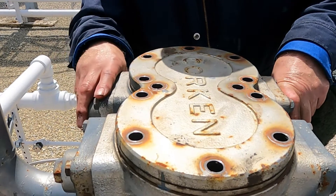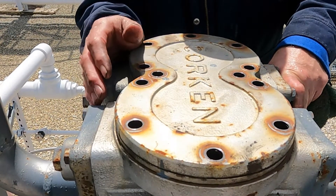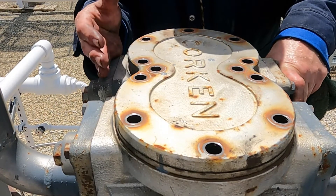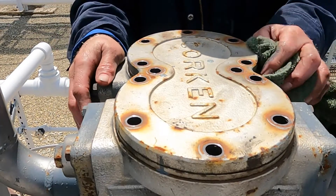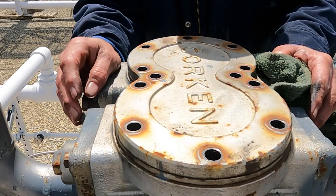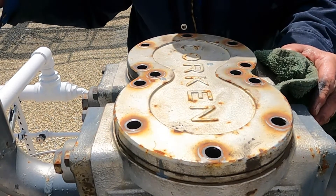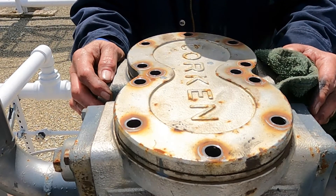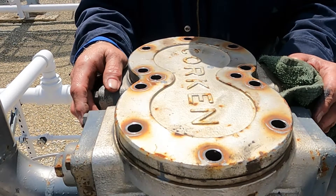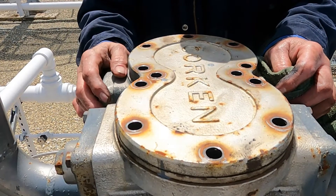When it comes to the intake and discharge valves, the old style of valve had metal as the moving material. They switched on the 891s two or three years ago to a material called PEEK. PEEK has far superior heat distribution, so they last a lot longer. In the past I used to change all eight valves once a year; right now I'm looking at about once every two years. I'd rather spend the money and keep good quality valves all the time, simply because I only want to take these things apart once and not keep repairing things as they go bad.